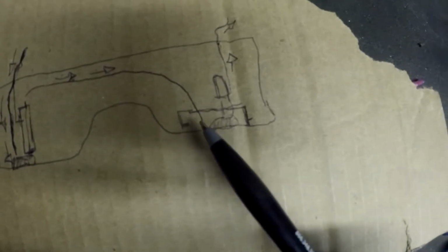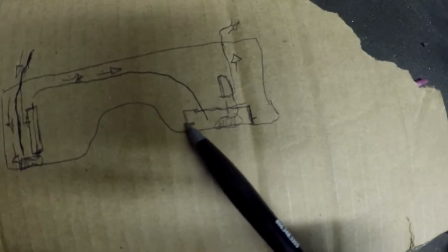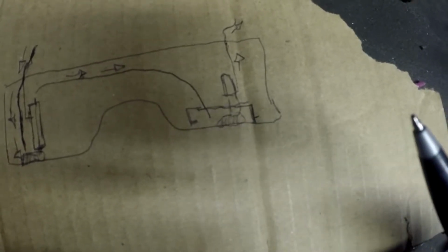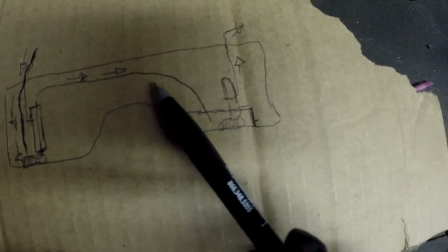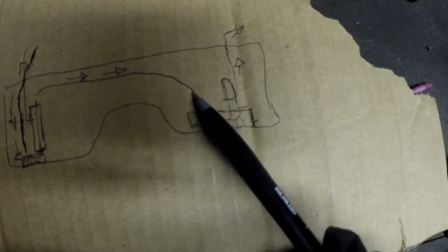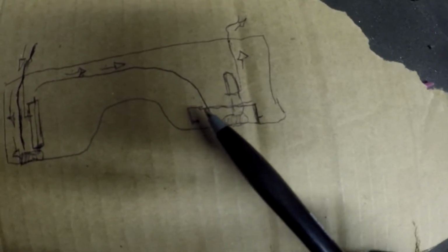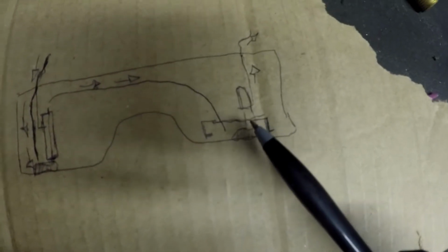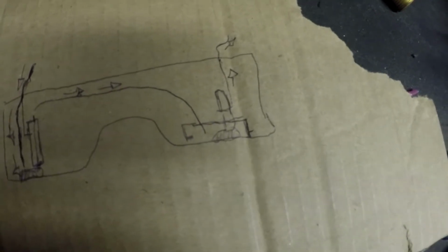Now, in the stock BMW, right here's almost like a cut-off milk jug, and it's got some slats in the bottom, and it's kind of like a little storage to help with the fuel starvation issue. So the line comes from the outlet of the other pump, and it comes in, and I actually have it secured into that tub, so it's always pumping into the little reservoir for the Walbro. So it's almost like having a pump in a surge tank or a pump in a tank.